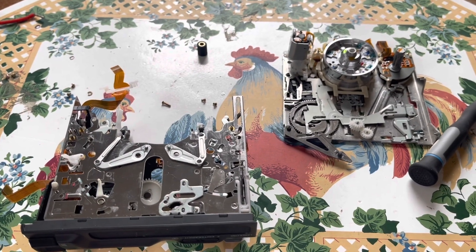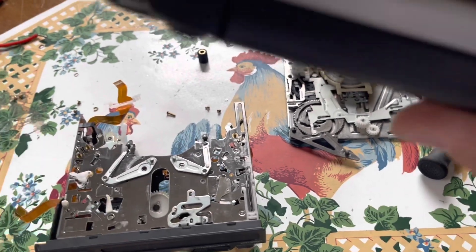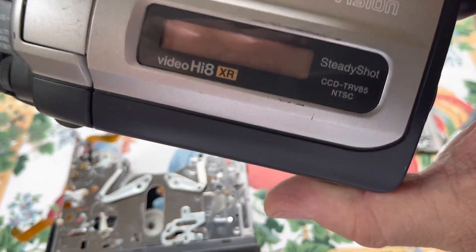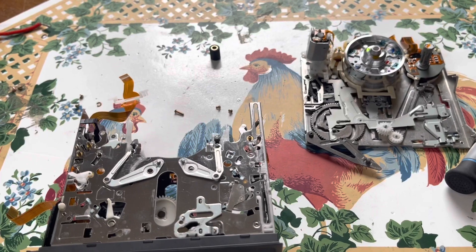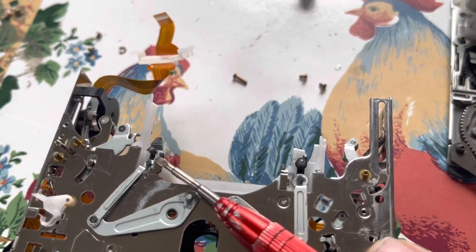This is going to be an inside view of the Sony CCD-TRV85 because I'm not going to be able to repair this one. If you see this guide right here, you can see how that's nice and round. If you look at this one here, it's not nice and round — it's actually broken, like part of it is lifting up.